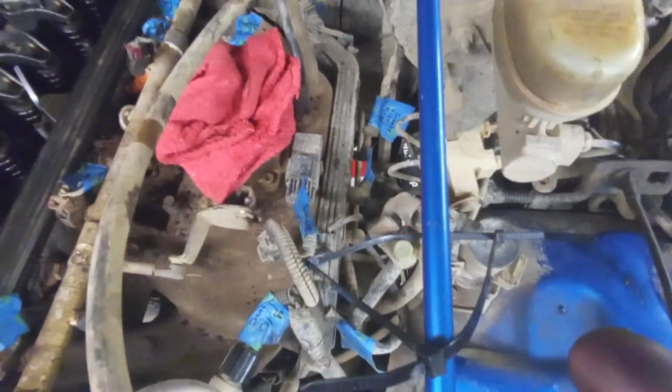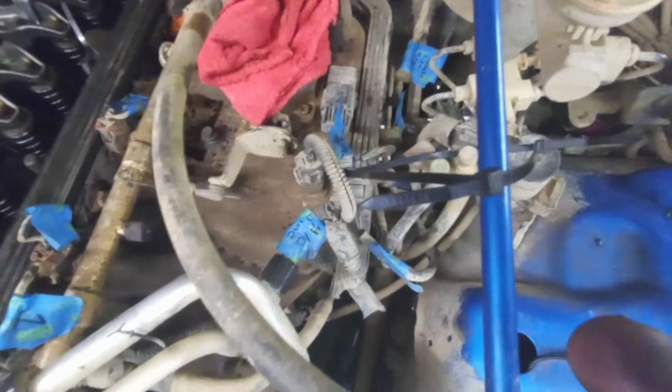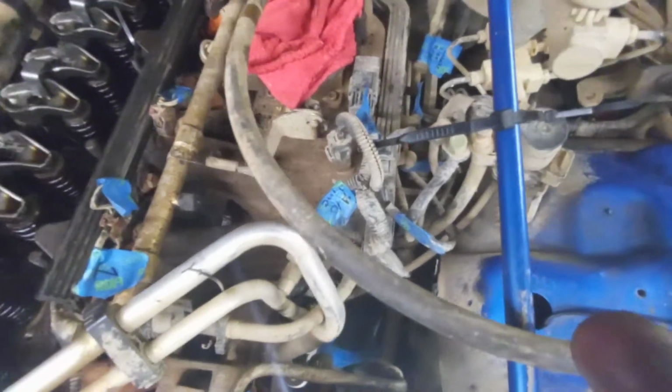I'm pretty sure, except for the injectors, that every plug in this engine has its own home. I mean by that, it's got plastic keyways where the two ends will only go into one connector. Except for your fuel injectors. Don't mix those up. Make sure you mark each one of them and where they go.